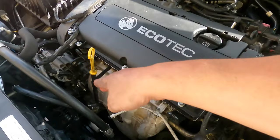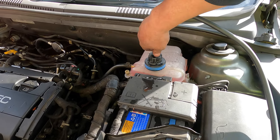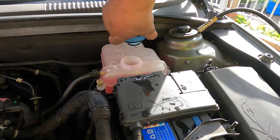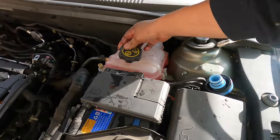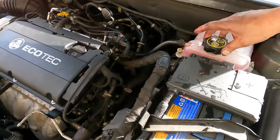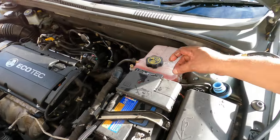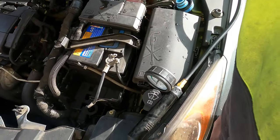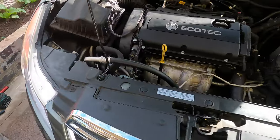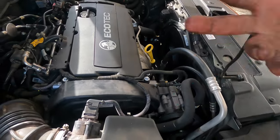Make sure all the air is pushed in and circulates through the radiator and through the pump - then it should be working good. Now it's working good, no more air. The water got warm - now when we turn on you see the fan keeps turning. That means the engine hasn't got enough water going through and the sensor is going hot, turning the fan. Press and blow to get the water pump some water, it starts to circulate, and then everything should be all right.